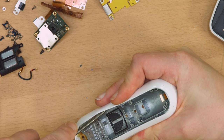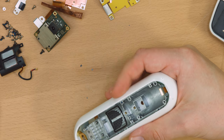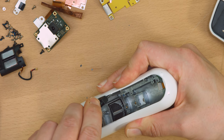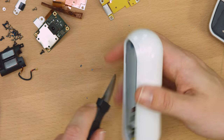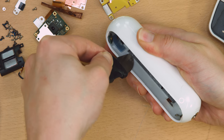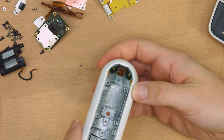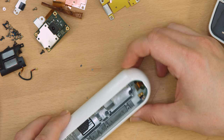Because it's glued on three sides and due to the shape of the case, I don't think it can be removed in a non-destructive way — or at least in a lazy way. That being said, I don't think it hides any real secrets. The only components remaining in there are the side button, the microphone array which consists of four discrete mics on the top, and the antennae which are located on the bottom.